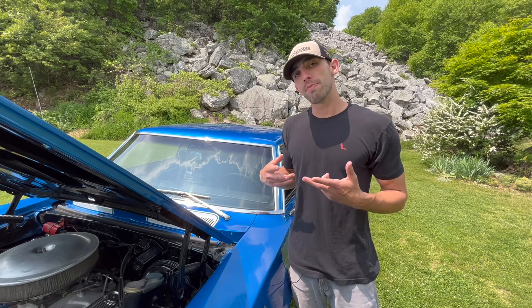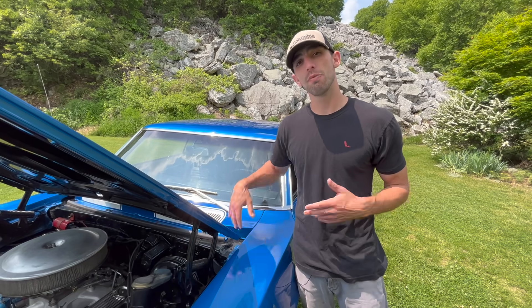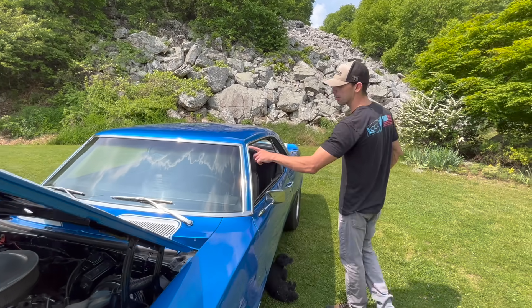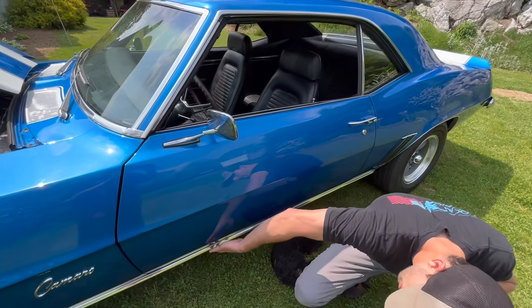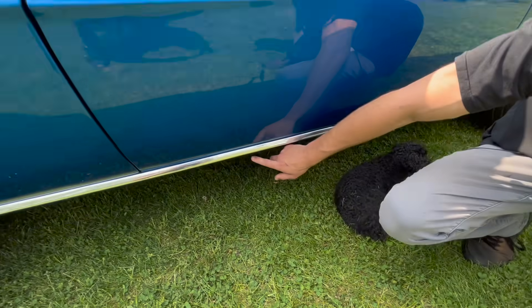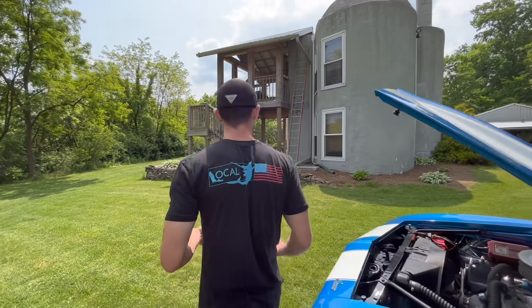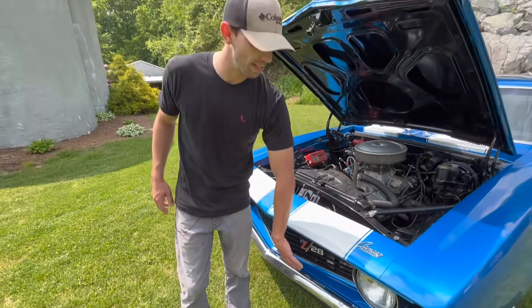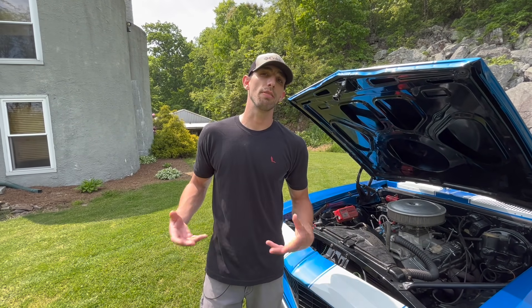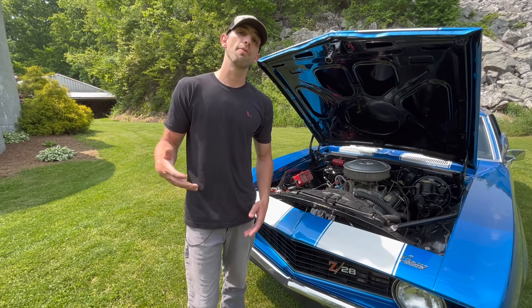At a Norwood assembly plant car, there would have been two X codes: either X33 or X77. The X33 code means it had the style trim package — the chrome lip, gills in the side, and the rocker spears painted black. X33 69 Z28 Camaros are the only Z28s that came with hideaway headlights. If you have a car with an X77 code but it has hideaway headlights, that would be incorrect. Also, all Z28 grills were silver unless it was a hideaway headlight car, in which case they were black.